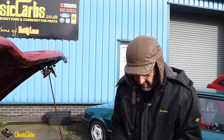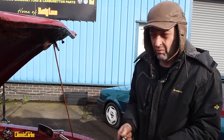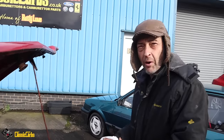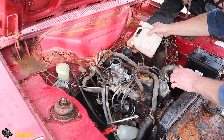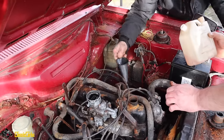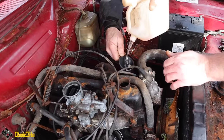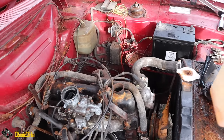You think the rings are seized? Okay. This is just a way of getting them free. If you put oil in and soak it, as soon as you spin it out with this oil on the plugs you won't get a spark. With a two-stroke petrol mix, you've got it. It's liable to pop. If it goes pop, I'll get a runner. That's semi generous. Okay. Right. How's that? Well, that's a rich mixture, isn't it? Two stroke engine oil. Whatever. Yeah. We'll leave that for a bit. Oh, do we have to wait now?